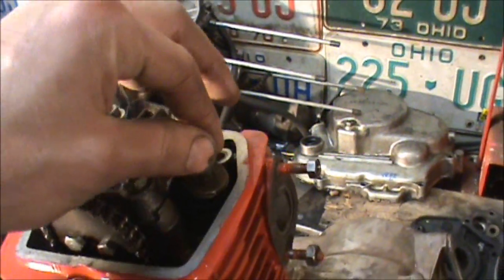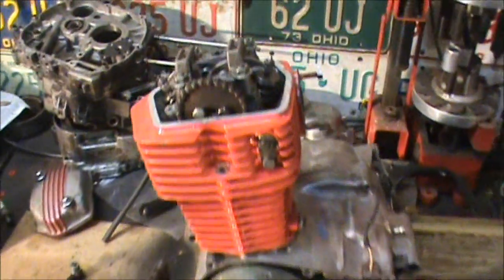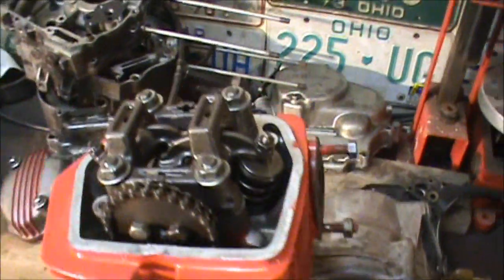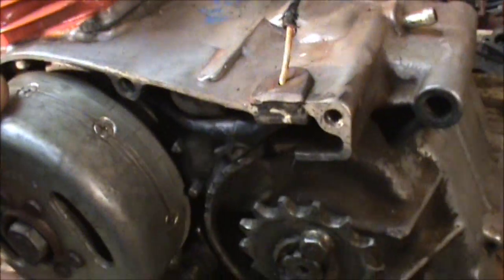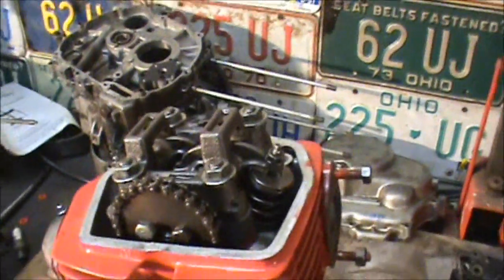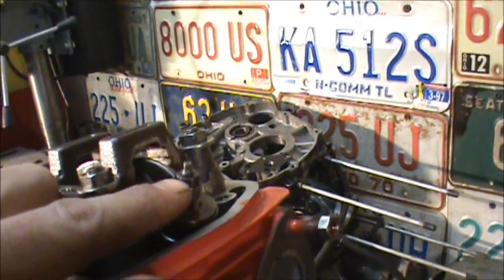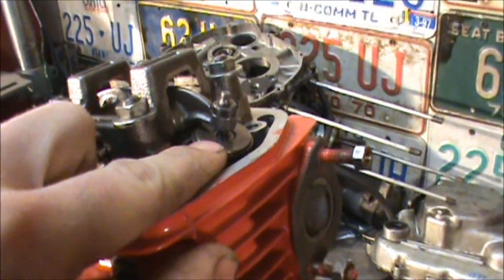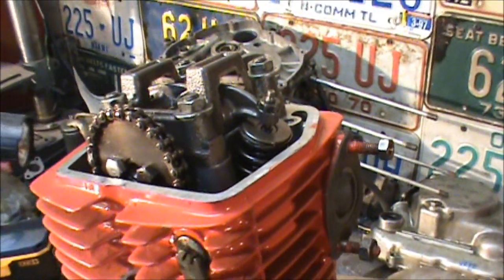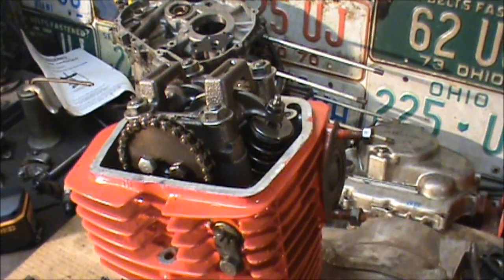It can also be your valves chattering. Adjust your valves — make sure your engine's cold. If you've been riding it, just let it sit overnight. Line up your sprocket here, verify on your crank that you're at top dead center, and if you're at top dead center with a cold engine, you should have slight play in your rocker arms. I'll put down the specs for this and edit in the intake and exhaust valve clearances. You'll loosen this little lock nut here, put your feeler gauge down in here, and tighten down the little bolt right on top to the correct spec with your feeler gauge. Do that on your intake and exhaust side, and that might help quiet it down if you're getting a little chatter.